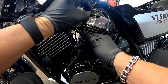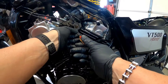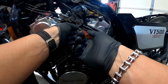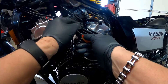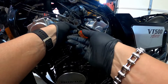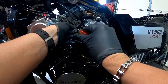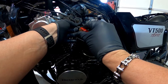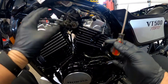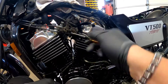The rear cylinder runs hotter, so they might have that carb set a little richer naturally. I'm just going to keep both of them at two and a half. When you go all the way in, just feel it start to stop — don't cram it in there because you'll hurt the O-ring. One, one and a half, two, two and a half — right there. Now, since the plugs are gone, if I want to tune it while I'm syncing the carbs, I can just access them easily — boom, boom, do my tunes.